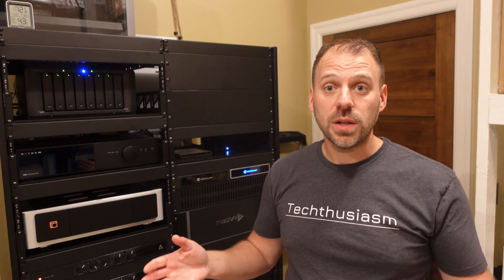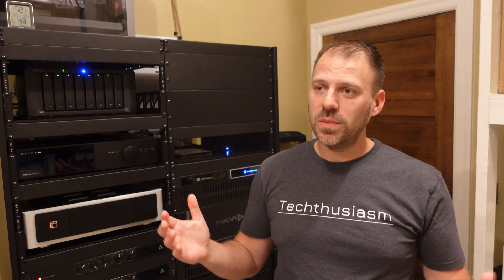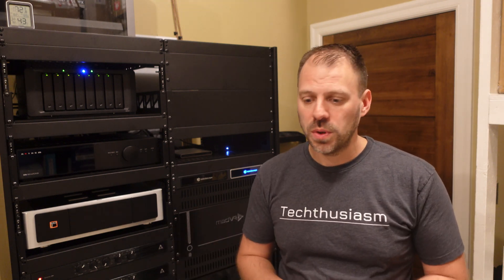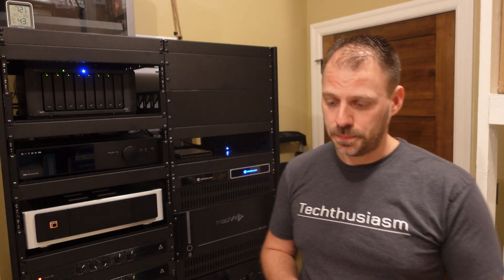I didn't want to cut corners. I like the fact that it's 2.5G on every port — I see a lot more 2.5G networking coming in the future as devices get refreshed and upgraded. I didn't want to be limited if I bought a 48-port switch with only 12 ports at 2.5G. I also didn't want some ports to be PoE and some not — these are all PoE Plus ports. There are no PoE Plus Plus ports, but I think the 30 watts or so that a PoE Plus port delivers is going to give plenty of power for the types of stuff I'm planning to connect for a good while to come.